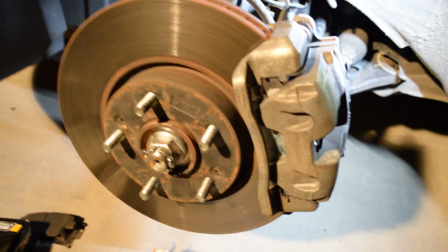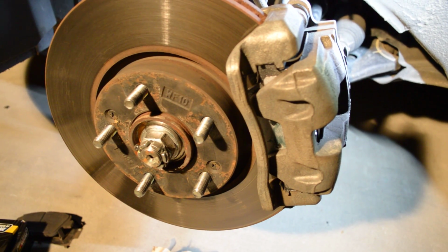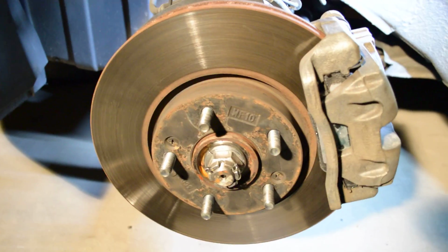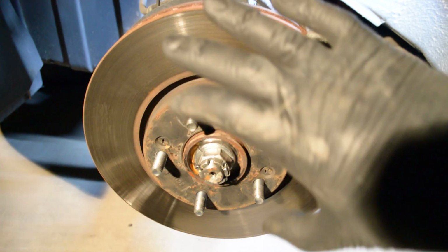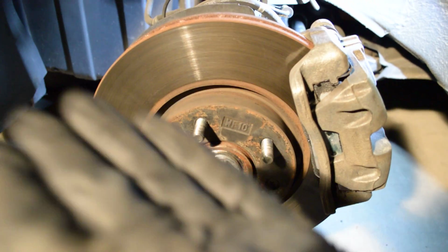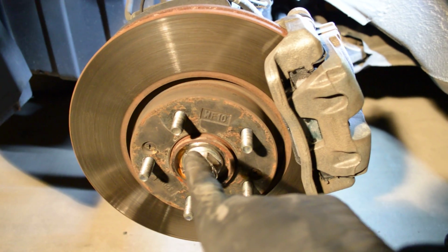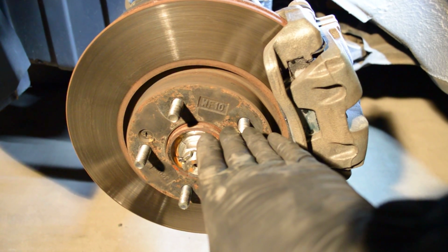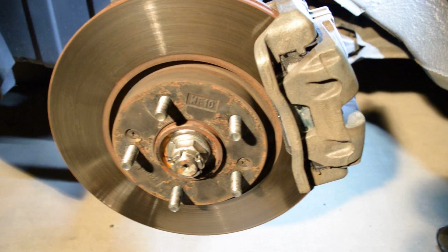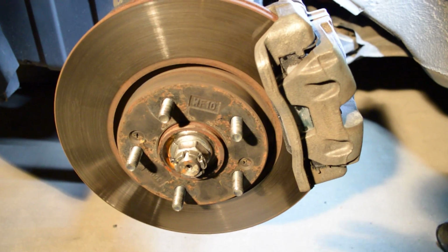Let's put the tire back on. Let's torque it to spec, anywhere between 80 to 100 foot-pounds. And I always use a torque wrench. Always, every single time. I've taken vehicles to where they change tires and they think they know everything, and they replace tires 100 times a day, and they use an impact to put the lug nuts on. But guess what? They are not doing it properly. They changed the tire, put the rim on, and torqued it down, and there was a noise that wouldn't go away until I had to remove the tire and replace it.